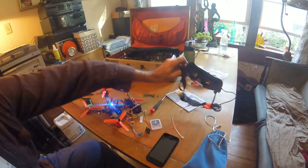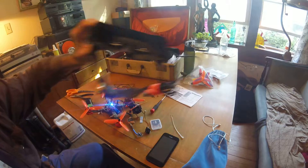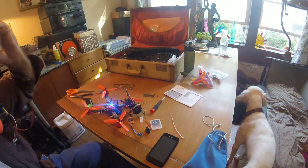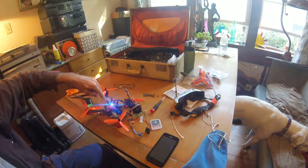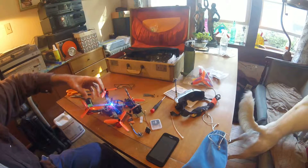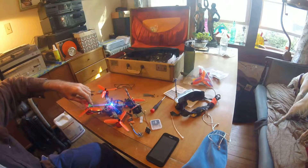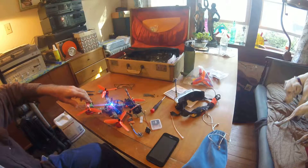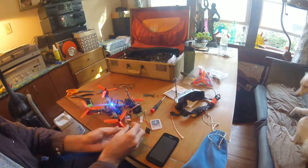So I'm going to try a capacitor. I ordered a 16 volt 100 UF capacitor, and I guess that's too low of a voltage, so I'm going to get a 24 volt or something like that, and just put it here and here — closest to the battery, they say. And that'll kind of absorb some of that back pressure, whatever you want to call it, for the dampened signal during braking.